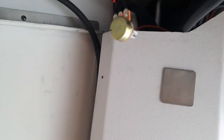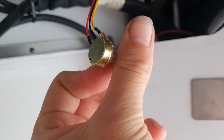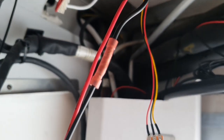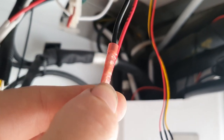You can regulate it with this potentiometer, which we will later put all the way next to the switch, so we're going to have to cut these wires as well. Our intake blower fan — this white one, this yellow and black wire — you have to follow it all the way back here, comes out up here. We've attached it here just with some crimp lugs. I didn't feel like soldering last night, so these are a pretty quick and easy way, or if you're not good at soldering, also a very good way to join wires together.